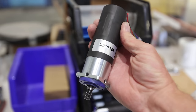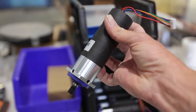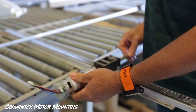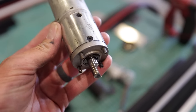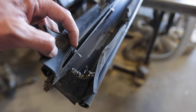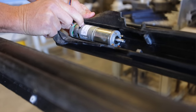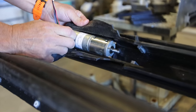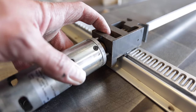Let's start at the top with the motor. The motor is going to be about the same — usually a 300-to-1 or 500-to-1 motor at the top. That's not a bad element on the Schwintech system, but the way it mounts to the system changes drastically how it functions. On the Schwintech, there are basically four pins that sit on top of the bracket and nest in place, with just one screw holding it to the U-channel. You can see there's quite a bit of slop inside that motor. If the motor moves up a little bit, it's going to spin and shear those wires right off.